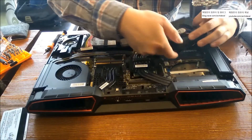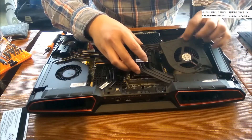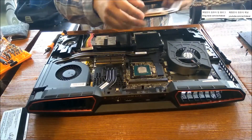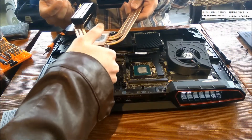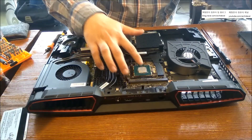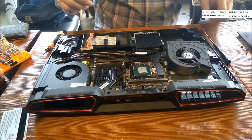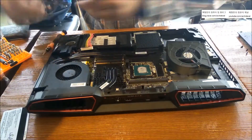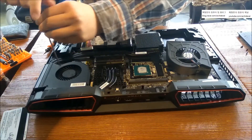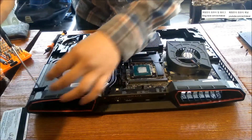Simply, the heat sink can be taken out. You can take off the fan cable too with your fingernail — you don't have to use a tool. The thermal paste was still working well at the moment; it wasn't hard. Probably it was time to replace it, but to show how it's done I worked on this laptop anyway.